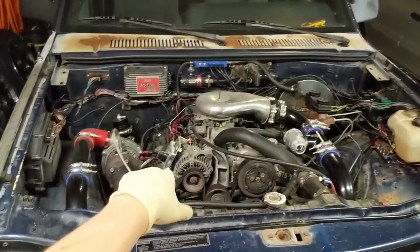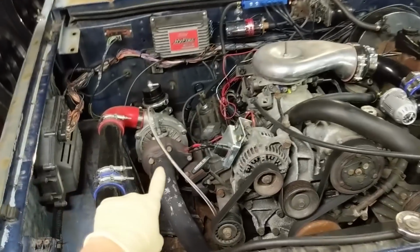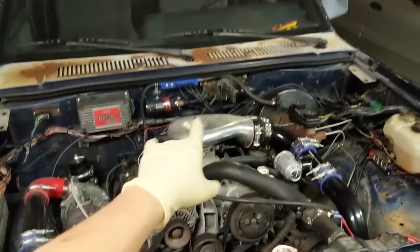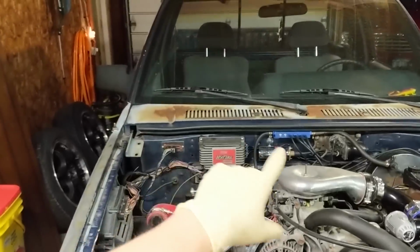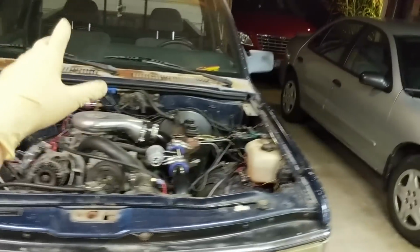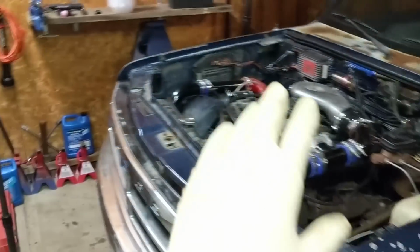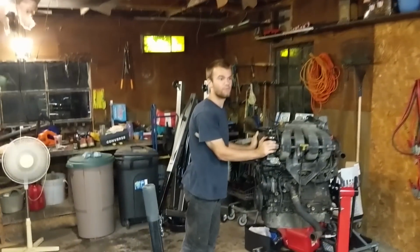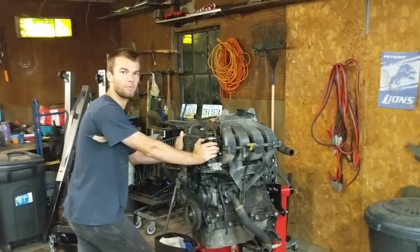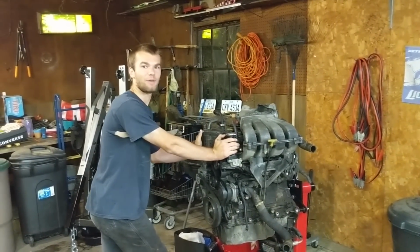Also, don't forget, Jacob has this, a V6 Dakota that he has turbocharged, and he's going to do some more upgrades to it, like a manual transmission swap. He's got it on a MegaSquirt with his own ignition system. He's figuring out the timing on that. He's working with the guys at DIY Autotune, who are helping him work out a crank trigger for this because it's got an uneven firing order. It's a V6 that likes to shake itself apart. It's very wobbly, and the vibrations are pretty bad. It's really bad with the manual transmission and solid balance, which is exactly what I'm doing. And a turbo. I'm probably going to hate this thing by the time it's done. It's going to be fantastic.